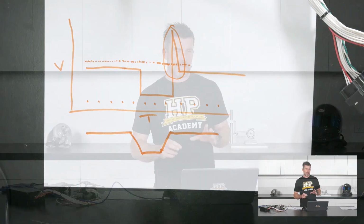Right, the other thing I'll talk about quickly, which is probably the most frequent cause of trouble when we're using an oscilloscope and don't understand how the scope works, is we hook up and we're basically looking at a blank screen with no signals. This can be really frustrating. So obviously we want to start with the basics. Have we got our probes hooked up correctly? Have we got good electrical contact to the conductors that we're trying to break into? From there, we also want to make sure that we've got sensible settings for everything.